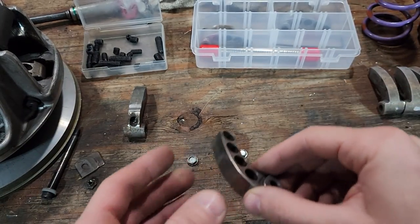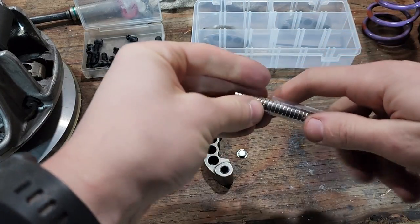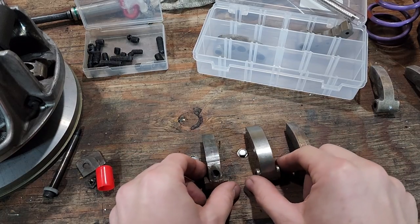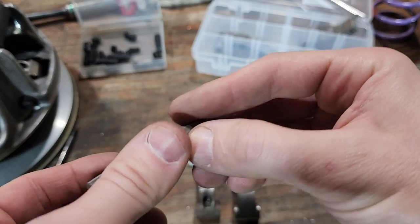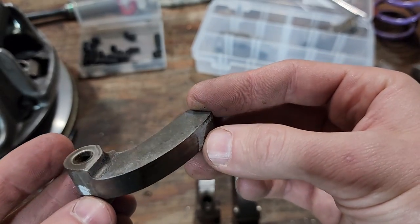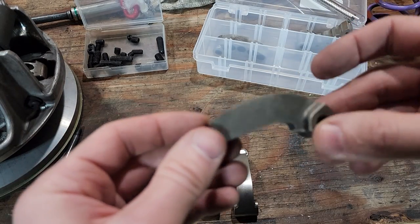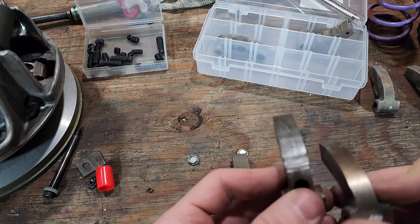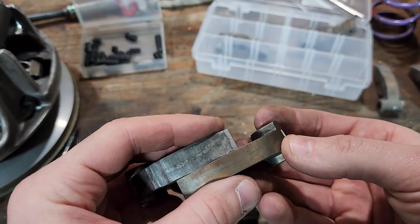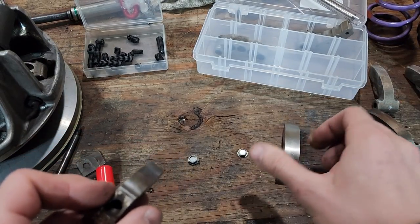On this new kit, the weights themselves are little magnetic things inside this tube. Let's check out the three different kinds of weights — they're all different. The stock weight has no adjustment, just a part number that corresponds to a certain calibration. The weight we took out has a wider ramp face for more contact with the rollers. The new SSI weight is even wider yet, making a lot of contact with the roller — which is what we want.